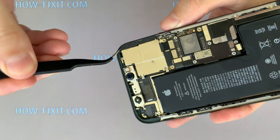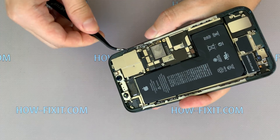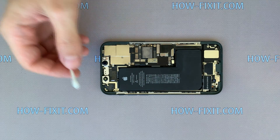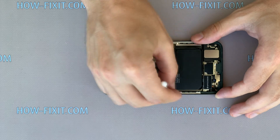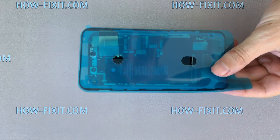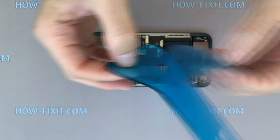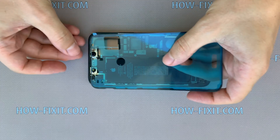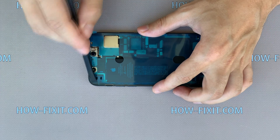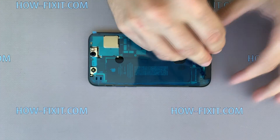Remove the silicone tape from the case of the iPhone. Now you can wipe the case with isopropyl alcohol. Apply the silicone adhesive tape, but before sticking it on the iPhone case, make sure to position it correctly. The silicone adhesive tape restores protection against water and dust, but it doesn't provide 100% protection from water. Press the sticker down so it sticks better to the case. If you don't have such a sticker, in the description under the video you will find a link where to buy it.